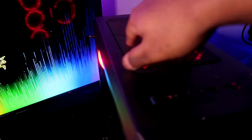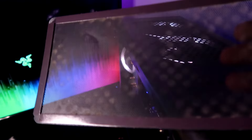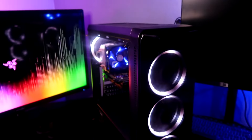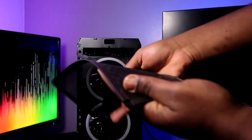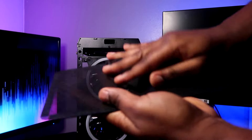It's important to note that the fan dust guards on the top, bottom, and sides — some PC cases have these in other places like above hard drives or where fans usually are in special cases. You want to make sure you remove these. Most of them are magnetic, and some just sit on or are screwed on. You want to make sure you take them out and give them a good wipe with a cloth that has either rubbing alcohol or a similar solution to get most of that dust out.